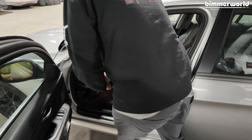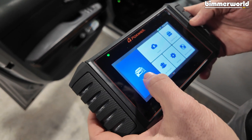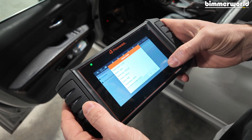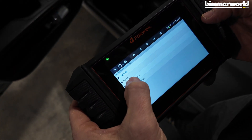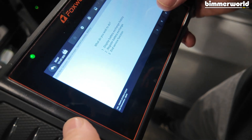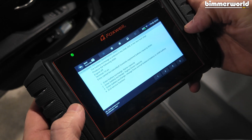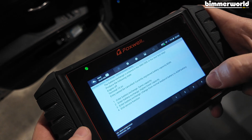Key in, car on. Wait for this thing to boot up. I'm going to go in here and do a diagnostic. I'm going to say it's a BMW — Smart VIN, let's see what we got. Reading my VIN information. That looks right — it's a 3 Series, 335xi. Yes it is. Special functions is where I would imagine I'm going here, because I don't need to diagnose anything. Register battery exchange. I'm going to call this fairly intuitive. What do you wish to do? Exchange history. Register battery exchange in service function — I would like to register a battery exchange. Higher, lower capacity. Look at that — number three: enter battery exchange from normal lead acid to an AGM. I think we'll do that.